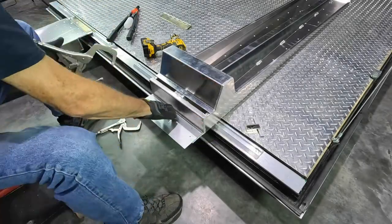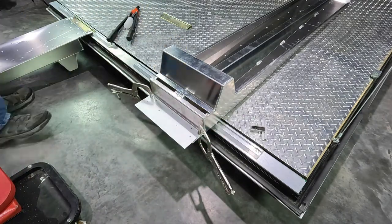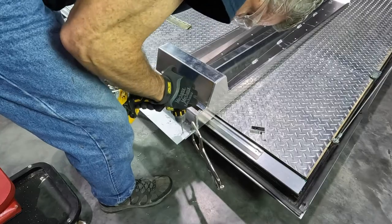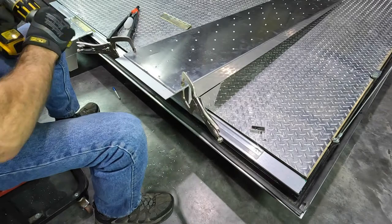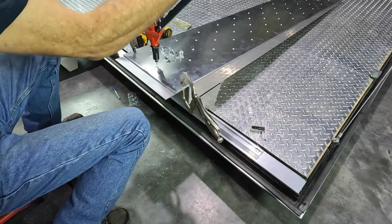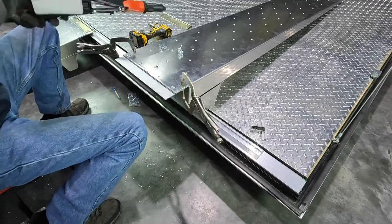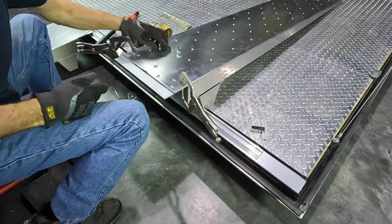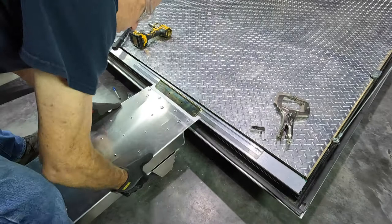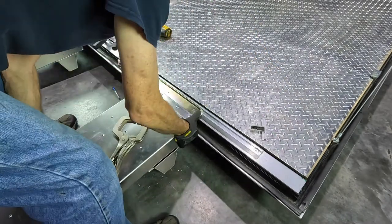Although these sliding tracks allow for a lot of adjustment in your ramp width, they also create a good-sized speed bump, which will be a constant nuisance every time you load and unload your car. Let's state the facts — we load our car every time about the same way. So really the adjustable ramp is for other things, usually a golf cart. After considering all the work and time this took, I would either bolt the tracks directly to the diamond plate on the door without modifying the back of the door like I've done, or just set the ramps with the hinge only and bolt those directly down and forgo the tracks completely.